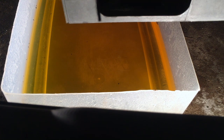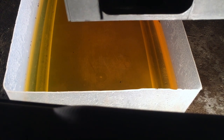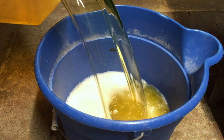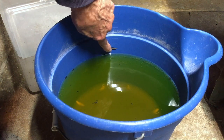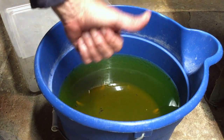About 20 minutes later, we're down to a slow drip. Let's measure this out — right where that black mark is, that is 10 quarts, so we should be right around there. We are just above the nine-quart mark, meaning there's about a quart still in the engine somewhere, probably in the heater core. So let's drain that.